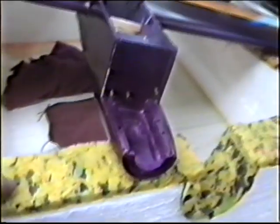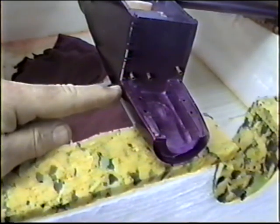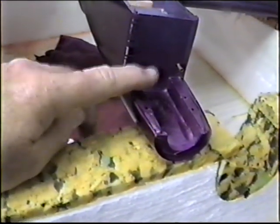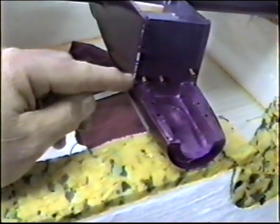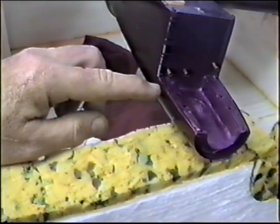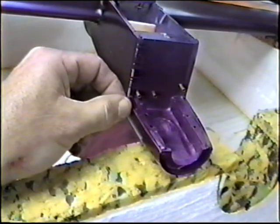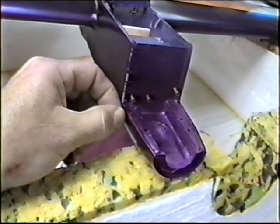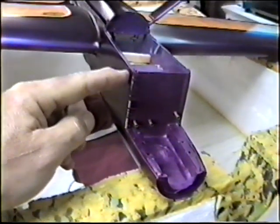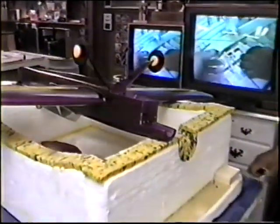Next dilemma is we have to figure out, we want to get the uniflow vent. In this case, we really only have one choice. We're going to drill right through the motor mount, because we want to ensure that we can get the tank in and out. He has other fuel tanks he wants to try. So we're going to try to center it off the motor mount, put a pinhole in there, make sure we're centered, and drill with an eighth inch drill, put an eyelet on it, pretty similar to the way we do all the other planes, but let the tube stick in here, and then that'll be your uniflow tube. You're going to also have to get one up here as a drain, so let's get that part of it started right now.